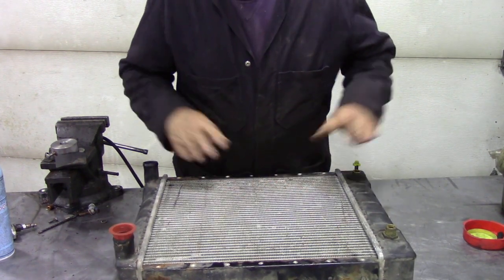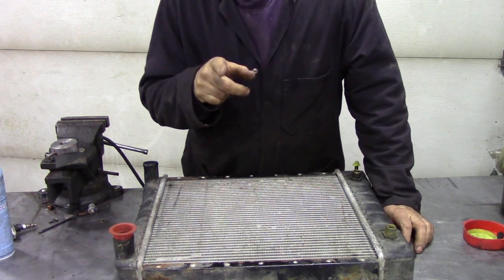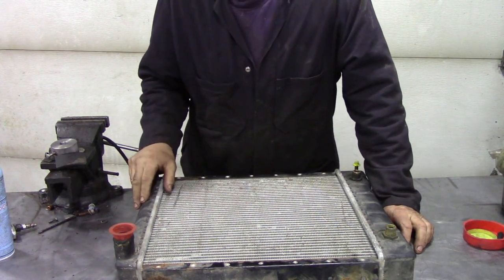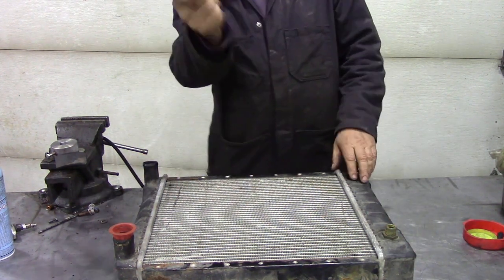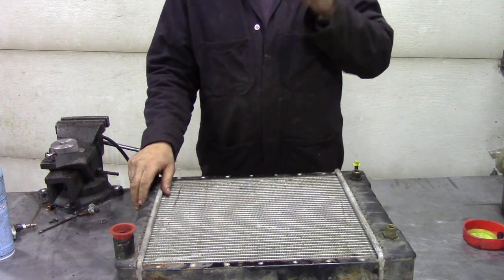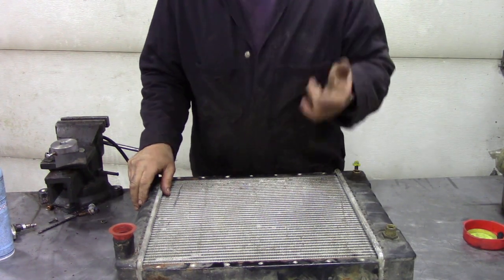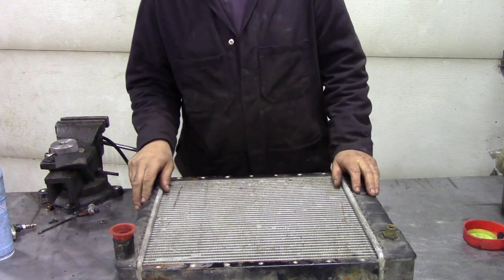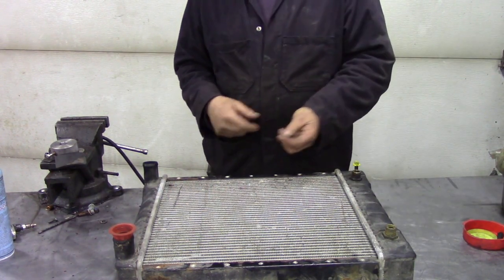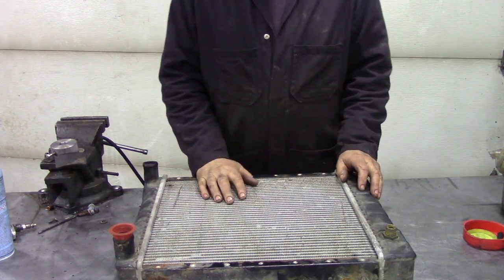So a really good tip for you: go to your Land Rover and power wash the radiator while it's in situ. Go through the grill at the front if you can; if it's got air conditioning, come through the other side. Power wash it through — not just with a hose pipe, that's not enough power — but obviously not with a steam cleaner at 3,000 PSI. Just one of those little Karcher or Simoniz power washers you get for your patio. That's not enough to damage the radiator.